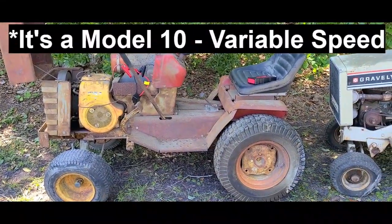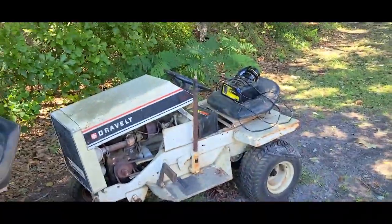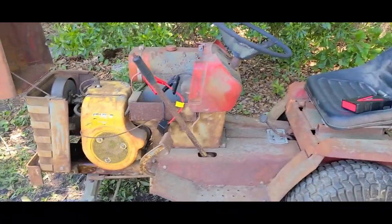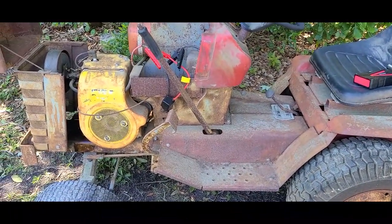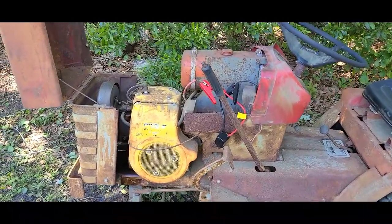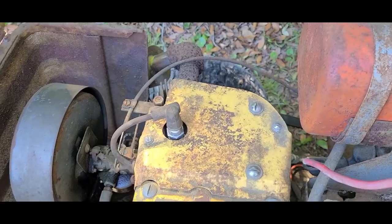And we just actually put some fuel in it. It had a battery in it, that battery right there. And I took the battery off, put the jumper pack up to it, and it spun over. I was like, well, shoot. So I took the spark plug off, and then we had good spark, and I said, well, shoot, this thing.